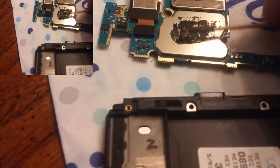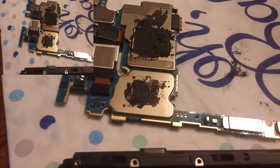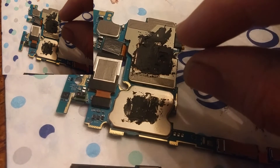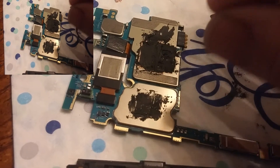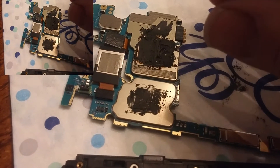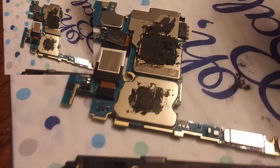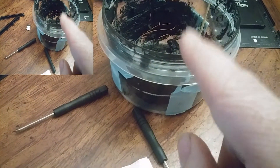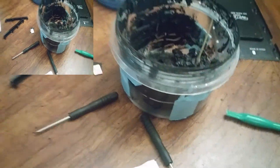It's not much — you don't have to put a whole lot. A lot of people will tell you just a tiny bit because you want a thin layer; there's less material to go through for thermal transfer. You just need it to touch and squish out. People doing overclocking do this all the time. We had a guy who did his Intel i7 with a four times overclock and had no thermal problems.